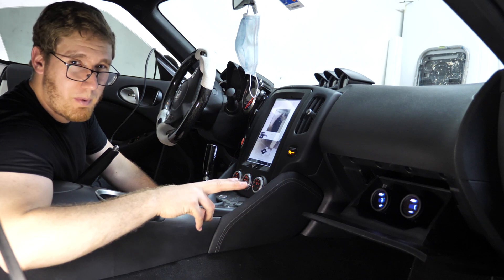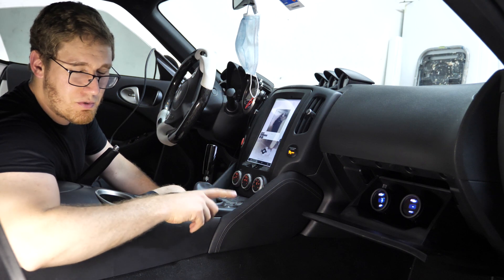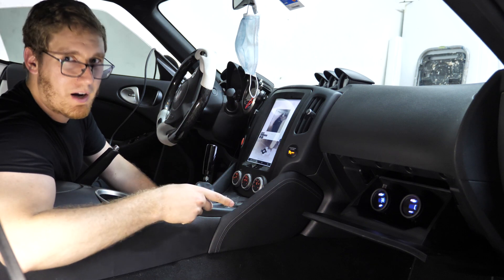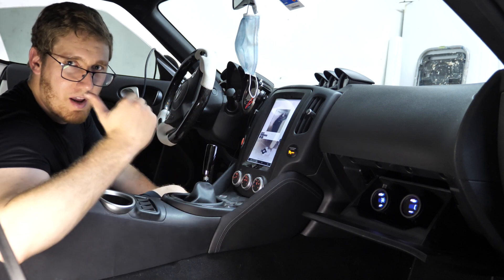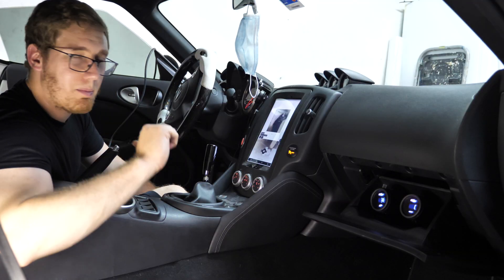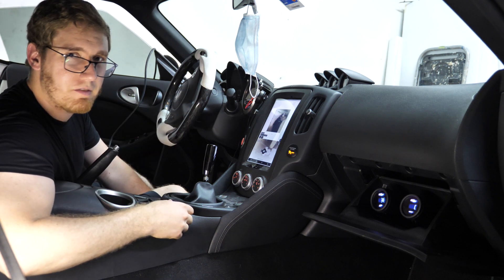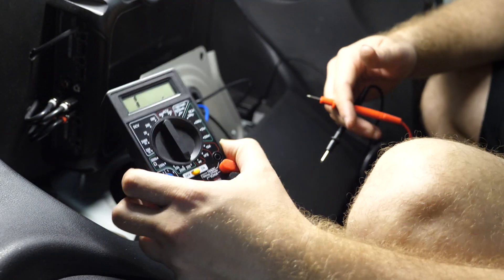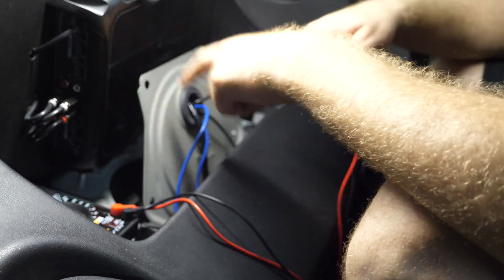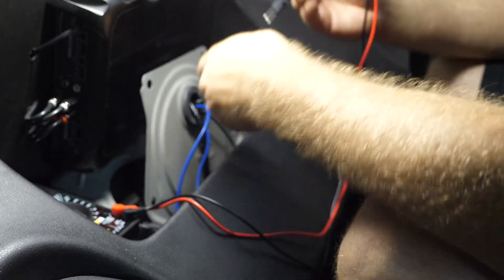So what's going on? Running those two pumps for a couple of weeks has been drawing current through the electrical system, which probably explains the burning smell. Before pulling apart the glove box, we can probe the connectors for each fuel pump on top of the radium surge tank. We'll take out the multimeter and measure across those pump pins.